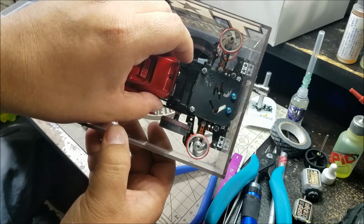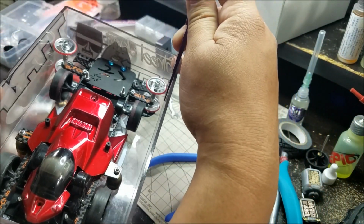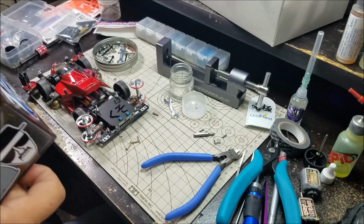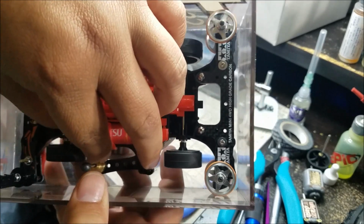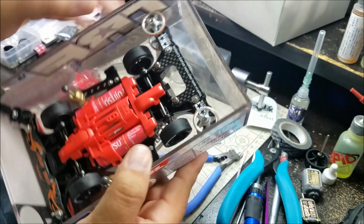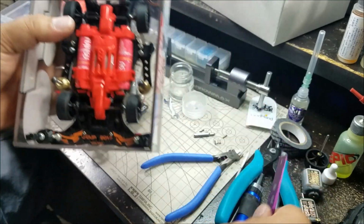As you can see, there's a lot of room. There's about, let's take a Tamiya gauge. There's about an additional 2 millimeters room left right there. Right, let us take this car and slot it in, and if you look closely, there's a lot less room. Now, why is that? The reason is because this 3 millimeter carbon piece, the hole mounts are actually slightly wider than normal. So if you, let me slide this over, you barely have 1 millimeter's worth of clearance left. It doesn't even have 1 millimeter. So it's already touching. On the other one, we still had about 2 millimeters left.